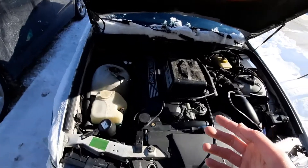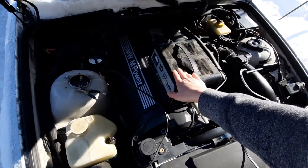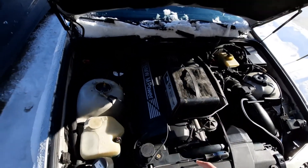I'm going to come around here real quick. Another thing to note: definitely plug your car in. You don't want the battery to die while you're flashing it — that'll break your ECU, and that's not a fun time.